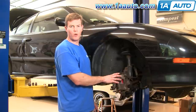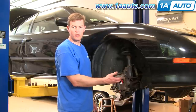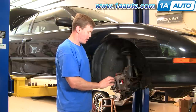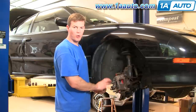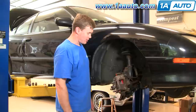So that's a little Disc Brakes 101. I hope I gave you the tools you need to check your brakes and see if you need new ones, and I hope I showed you how easy it is to do these brakes yourself. As you're putting this together, make sure those bolts are tight, then put your wheel back on and torque your lug nuts to 75 foot-pounds. Put your hub cap and everything back on and you're good to go.